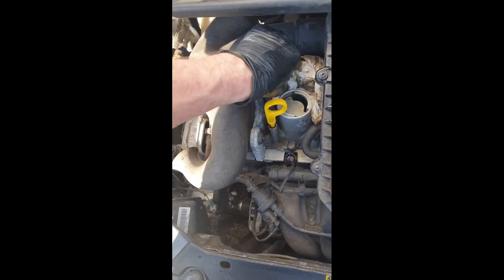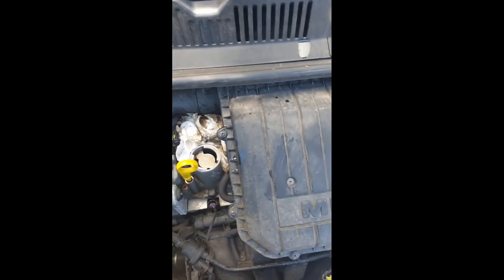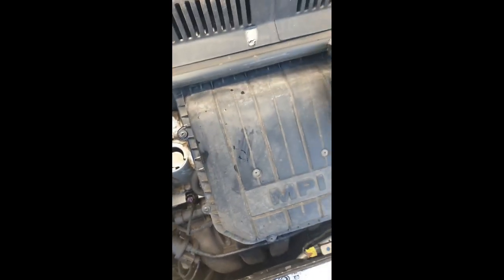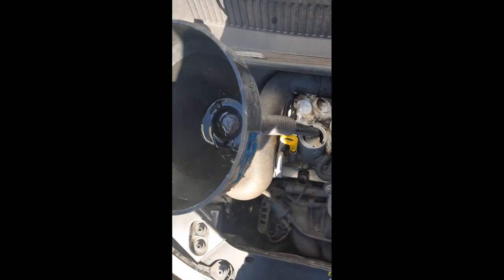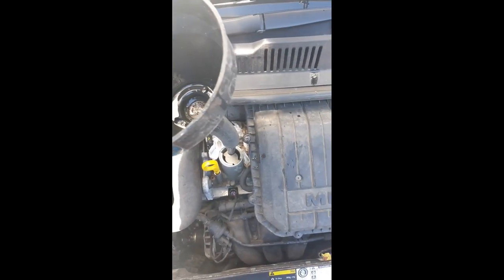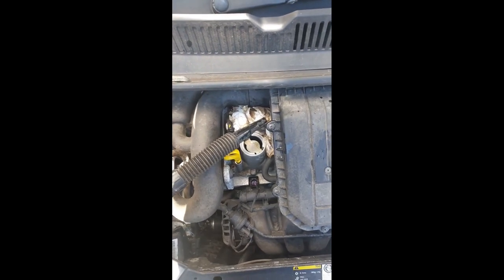Just some tips here — fill it up. This engine takes about three litres of oil. When I think I've nearly got there, I check the oil on the dipstick, and you can see it's not even on the bottom mark yet — I haven't run the engine yet, which also means the oil filter is not full. I use a funnel with a gauze in the bottom just so it cleans out anything that might be contaminated. I'll catch you back when I've completed that.